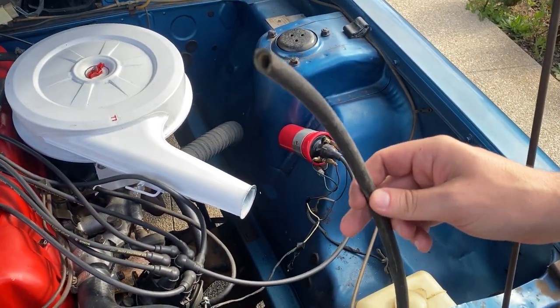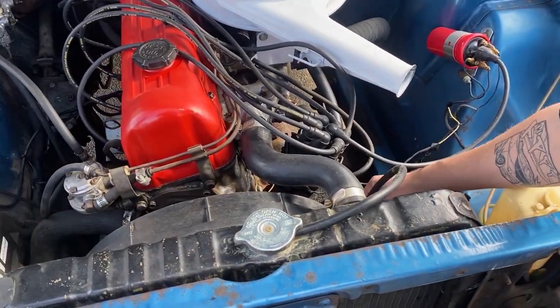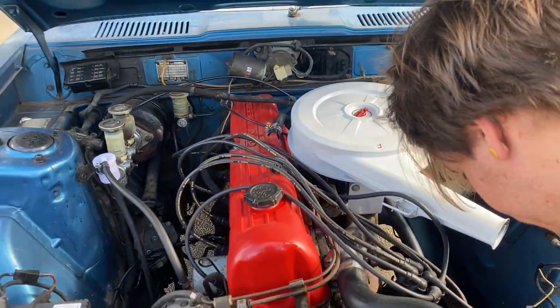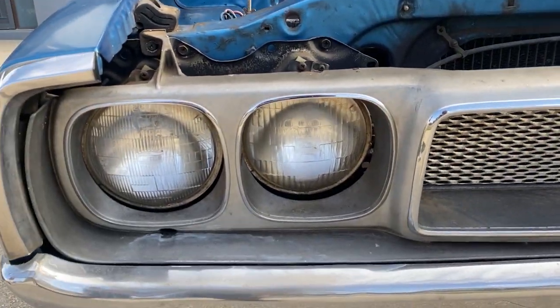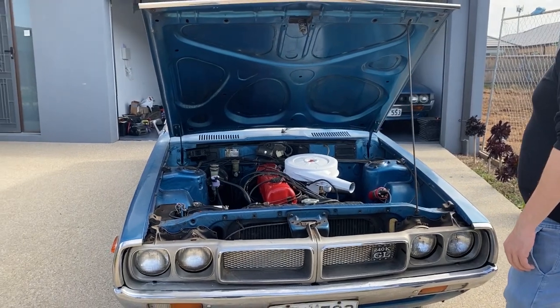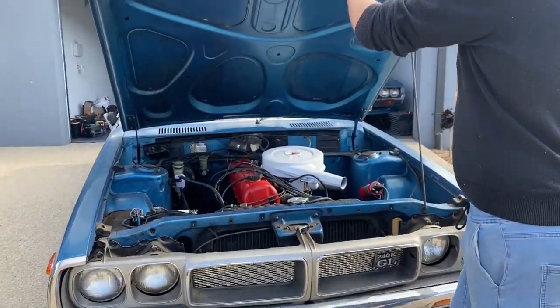This is a line that shoots down the fluid if the car is overheating and the pressure inside the radiator gets too great. Normally you shouldn't see any fluid coming out of that, but if the car is overheating, that does happen. And we are seeing a bit of fluid come out of there when we drive the car for a while. And the lights are all working really nicely. Everything is looking really good in there. Just need to do the spark plugs, and then in the next video, we'll fire the car up and we'll see it running, and we'll see how it sounds as well.